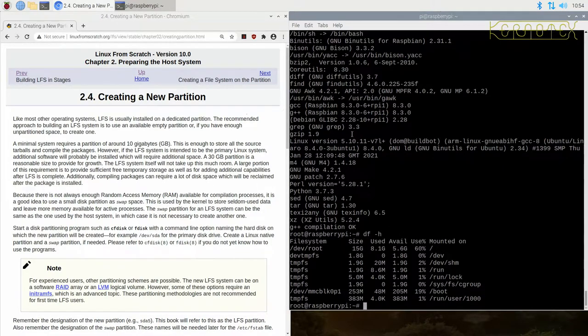What I will do is create space for a separate boot partition on the external disk and show both ways of booting when we come to that point. So I'll make room on the disk during partitioning, but I won't actually do anything with that partition until I show the method for booting solely off the disk without needing the SD card. If you do use that method, in theory you'll be able to take that drive and stick it into another Raspberry Pi and boot from it — quite useful.